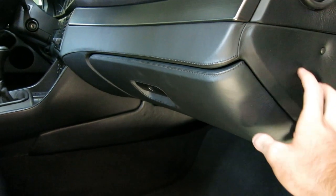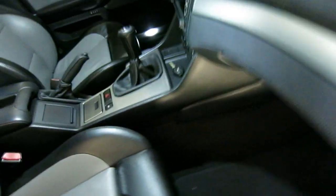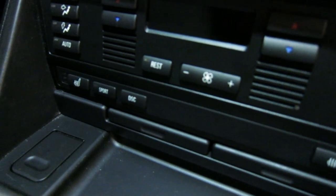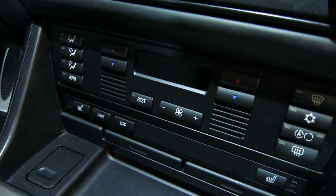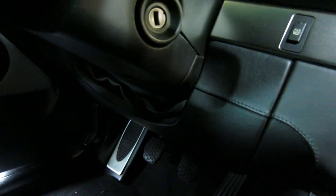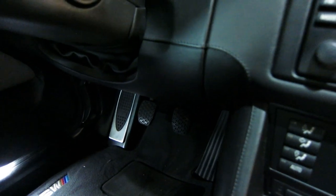Once you get up here, run it through and it's going to go into the glove box. There are fuses in the glove box that it has to plug into. After the glove box, there's going to be a couple more cables that run across the dashboard to the button switch panel. Once I replace that button panel, there's a connector back there and you're going to have to plug in two pins to give power to this switch panel. Then you continue running it under the driver's footwell to the front gong speaker.